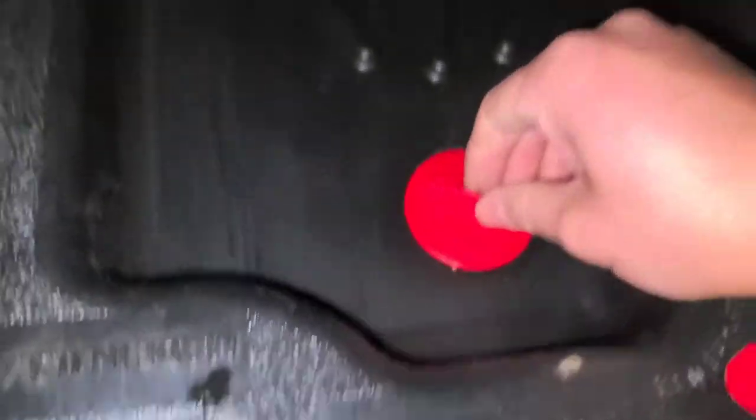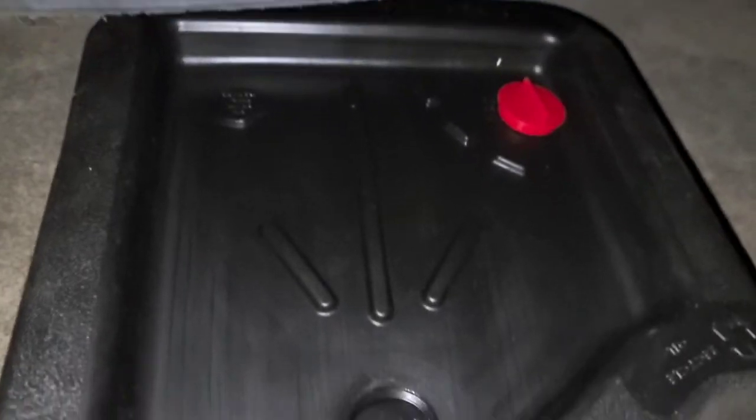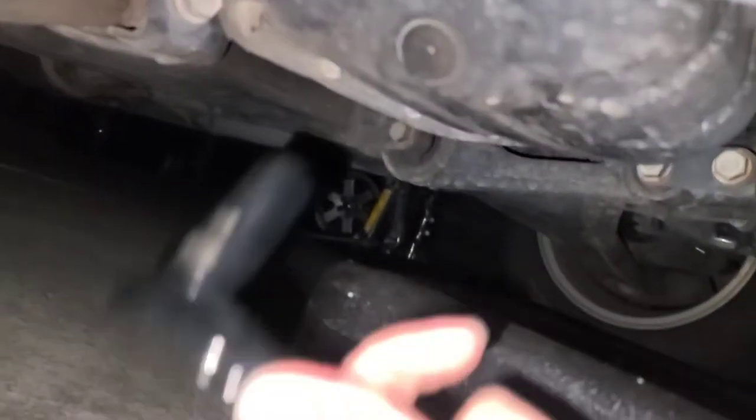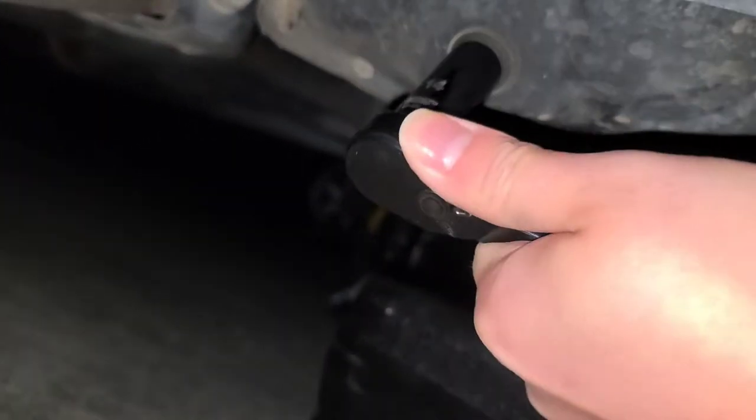Basically you want this oil pan drip thingy — make sure it's open. You don't have to get this specific one, but we'll put that under there. Usually what you want to do first is get the socket. Make sure you have it going the right way — that's in tightening mode, so you want it to twist counterclockwise to loosen the bolt. Get under the car, look at the bolt, and then you want to get this on, and twist it counterclockwise.